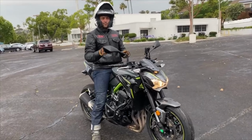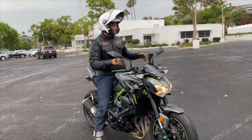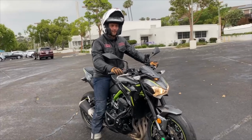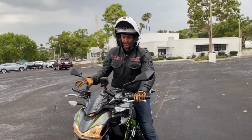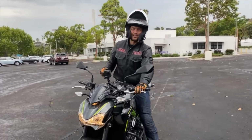So again, step one, I recommend practicing just using the friction zone, no brakes, and just going in a straight line, balancing, and seeing how slow you can go. Check it out. As slow as you possibly can go. If you feel like the bike's going to tip over, use your body, use the handlebars, but no brakes first. Just practice getting good at that.